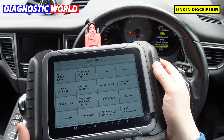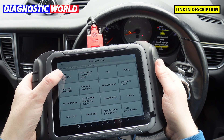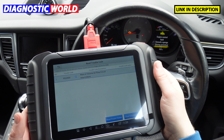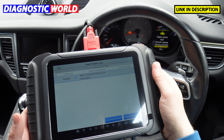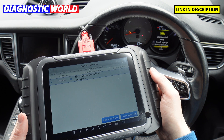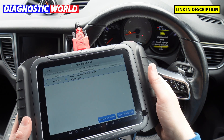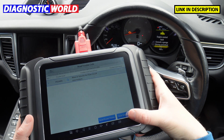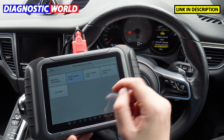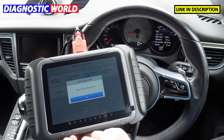When it comes to diagnosing a fault, what information will it give? This vehicle has the check engine light on. Going to Engine Electronics (DME) and selecting Read Trouble Code, it gives us fault code P0104 00 — mass or volume airflow circuit intermittent. We simulated this fault by unclipping the mass airflow sensor. You can then go to Clear Trouble Code, select yes, and watch the check engine light and warning message disappear.